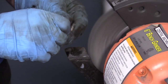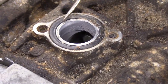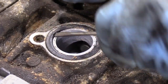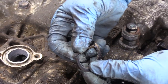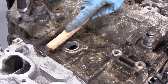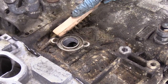Take a wire wheel so you can also see if it's pitted. If you have a wire wheel or wire brush, take advantage of that and clean all that corrosion off where the hose sits. Now I'm going to take the O-ring out — it's pretty hardened, petrified actually. Look at that — yeah, this has been leaking, just seeping enough. That's how stiff and old it is. So that surface is going to get cleaned using a brass brush and pocket screwdriver. Spray some parts cleaner in there to get it down to a good surface before reinstalling the new O-ring.